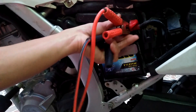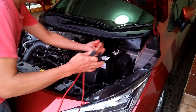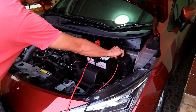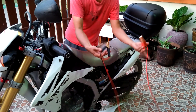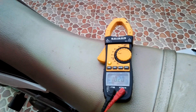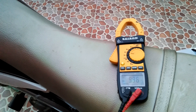At this point it is possible that only the battery is the problem. I need the battery charged and the bike running for my next test, so I go ahead and jump-start it with my wife's car. As you can see, the bike started normally. With the engine running, I measure the battery voltage once more after I disconnected the jumper cables — the battery voltage is very low at only about 10 volts and does not increase.